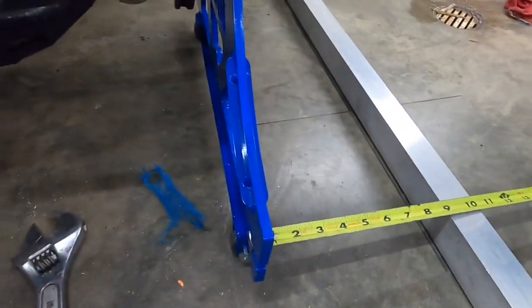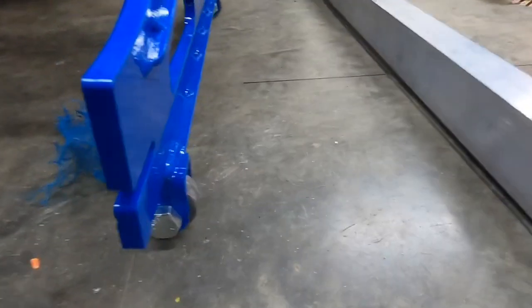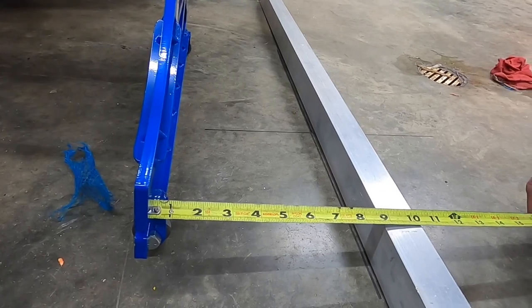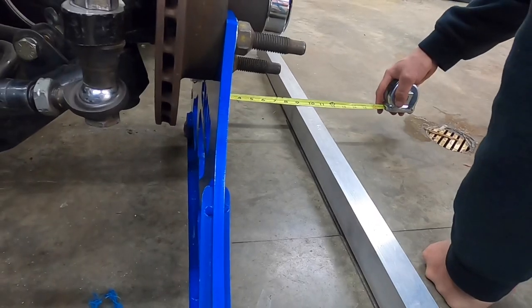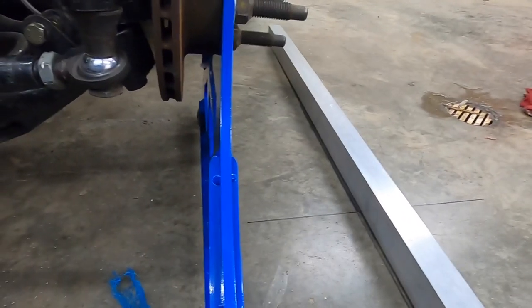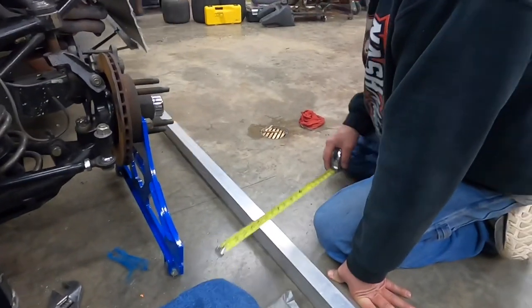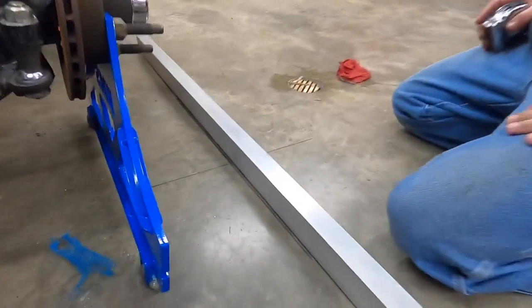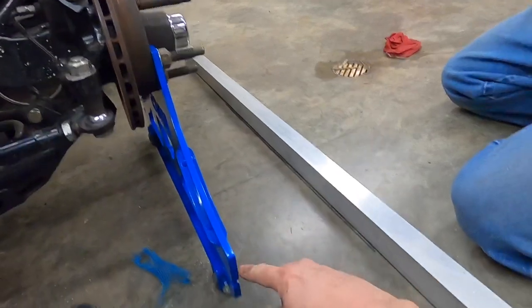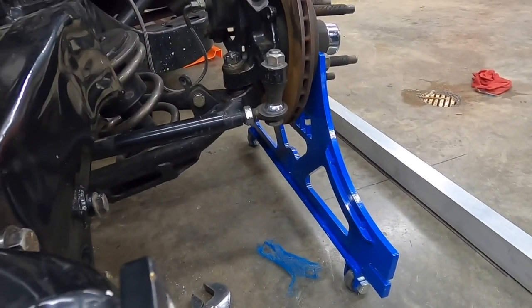All right, we got it there: eight and three-quarter. Check the back — eight and a half. So right now we're a quarter inch toed in. We'll turn this just a little bit — doesn't take much. Right now we're an eighth inch out. Go back the other way just a little. Five-eighths... straight up right there. We're putting ours straight up. From the Hammond plates, front and back, we've got the same measurement on both sides. Let's move over to the other side and put our toe out over there.